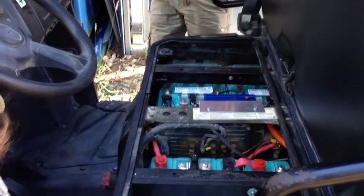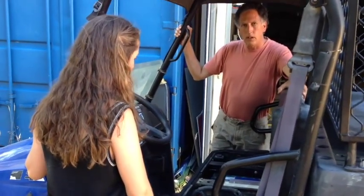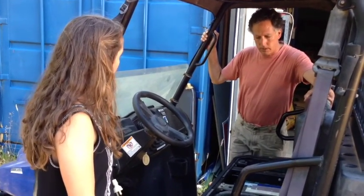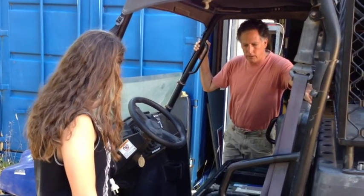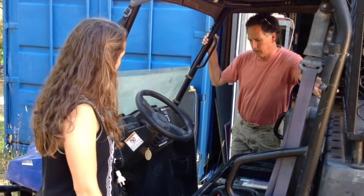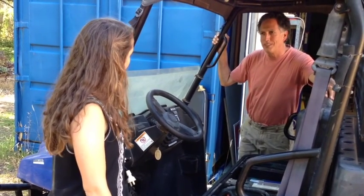So what are the differences between driving the vehicle with this retrofit versus how it was previously? Well, for starters it's a lot lighter — probably about half the weight of batteries in there, with at least 50 percent more capacity. The lithium batteries work at a slightly higher voltage, so you notice an increase in top speed as well, an increase in power, and obviously because the whole vehicle is lighter, its performance is better going up hills, as we've discovered.